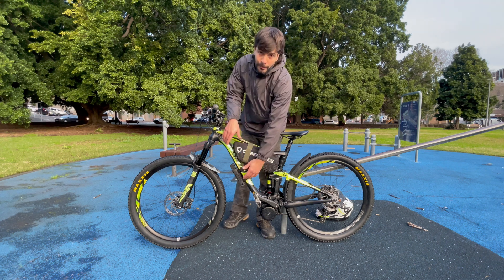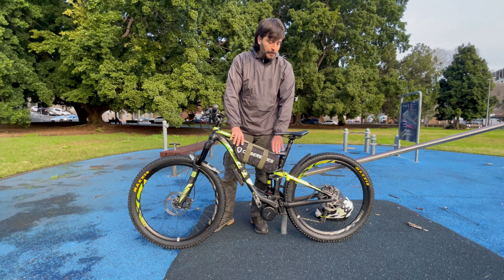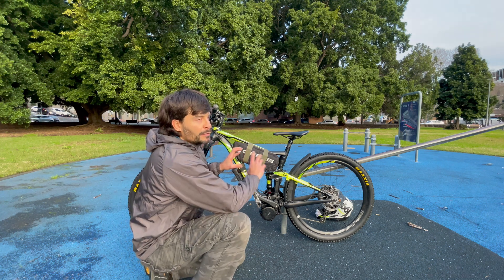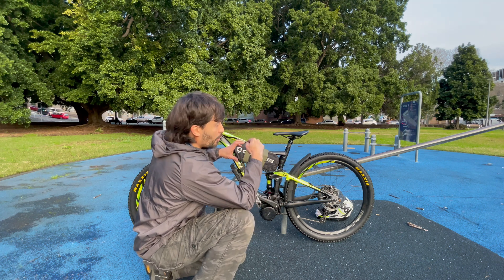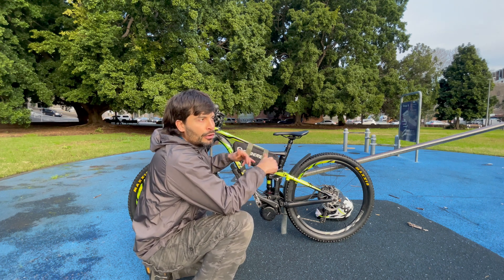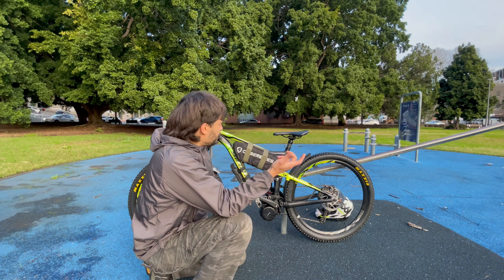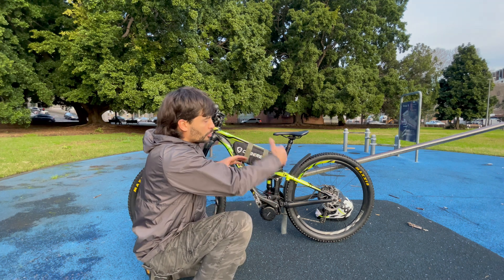This is a medium frame and the other bike was a large frame, so the 52 volt 17.5 amp hour battery would not fit on the down tube. I gave him the option of installing the battery on the upper tube but he didn't want that. So we turned the 52 volt 17.5 amp hour battery upside down and covered all the holes — the key barrel, the screw holes, and the output — with liquid electrical tape.